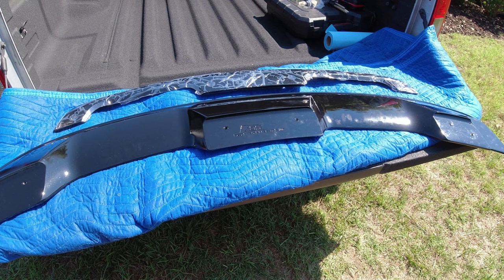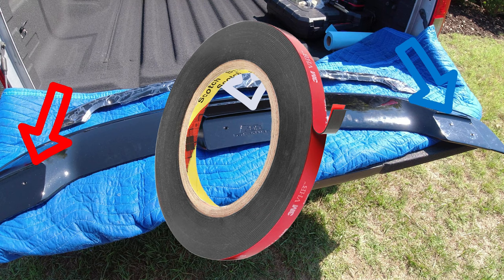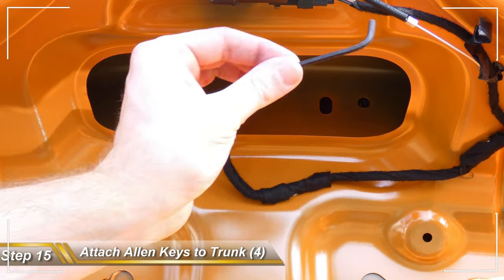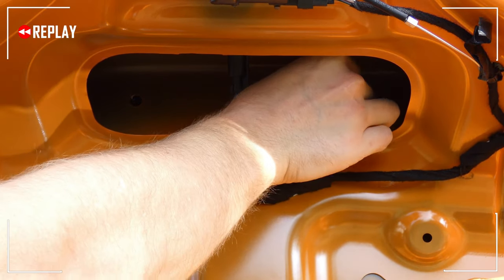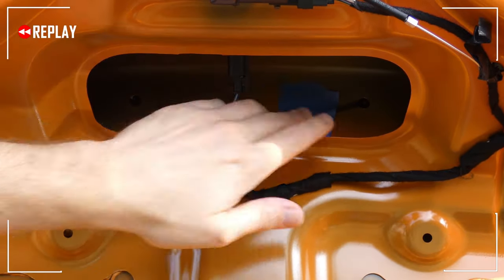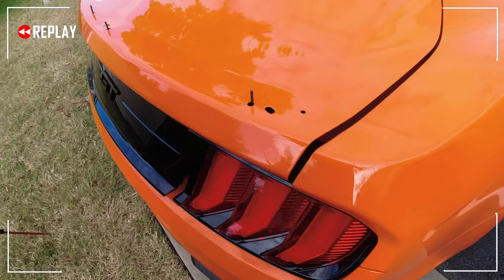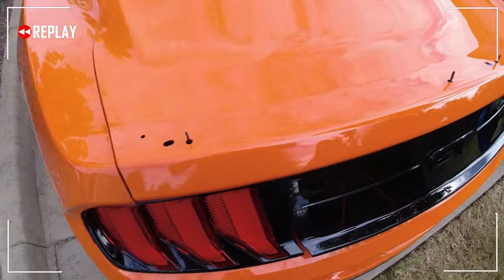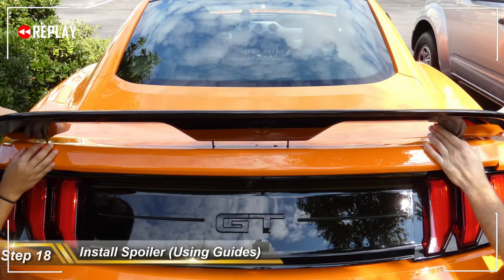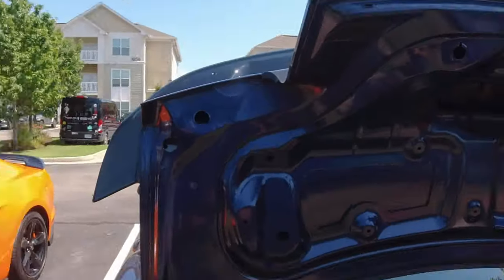Before moving forward on the installation process, this particular aftermarket spoiler didn't come with any double-sided tape attached, and it didn't come with a roll of 3M double-sided tape. If yours does come with one of those two products, here's how to install that: grab some Allen keys and some painter's tape, and tape those Allen keys to the trunk right through your spoiler holes. The Allen keys are going to act as dowel pins or alignment pins when you bring your spoiler and attach it to the trunk. This footage is from another video — a spoiler swap for a 2021 GT Mustang — and if you want to see this in detail, the link is in the top right of this video. You can see where the Allen keys are sticking out of the trunk, guiding that spoiler down beautifully. Peel off that adhesive liner, and with another person helping, guide the spoiler right down to the holes with perfection, then just press it down. That's how you do it if you have 3M double-sided tape on your spoiler.